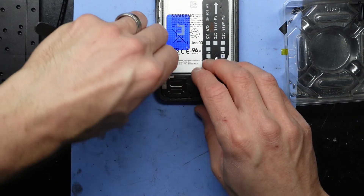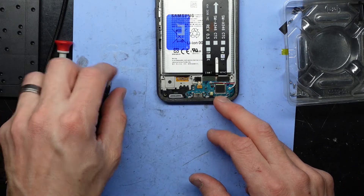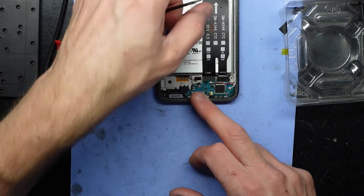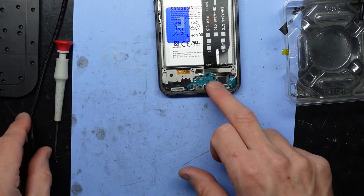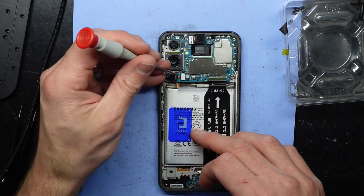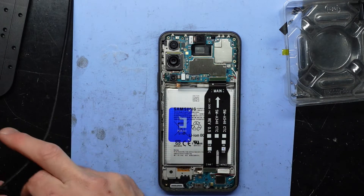I'm going to take this out and lift this up. We have the loudspeaker here, the under-screen fingerprint reader here, and the antenna connectors. What I want to do is disconnect the fingerprint scanner, and I do have to disconnect this one which goes to the screen. I should be able to take that one black Phillips head screw here and also one screw up here in between the cameras, and lift out that board with the antennas connected.